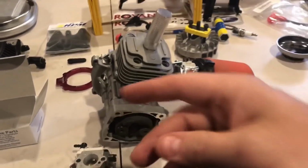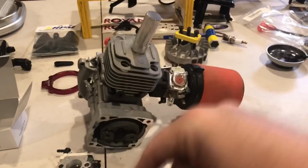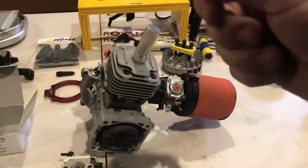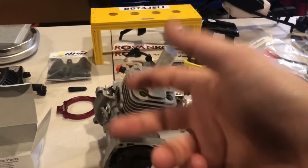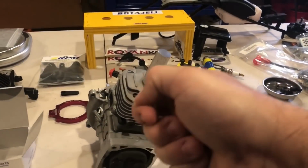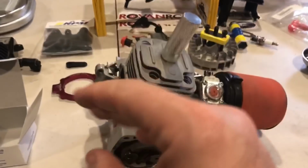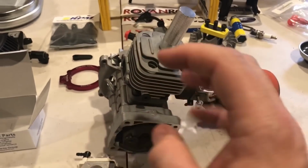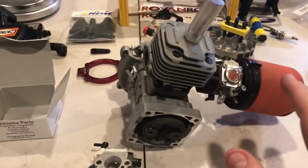So you guys know, you put the choke on first. Even with a choke, you go up and down with the piston a few times. Then you try to grab the cord. Try to get that feeling. Know when it's hooked. Know more or less where your piston is at. Then once it connects, pull on it. If you hear an explosion, like a brap, or if you hear your engine make a sound, stop. Do not keep pulling it. Go to your choke and take it off choke.